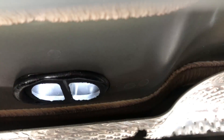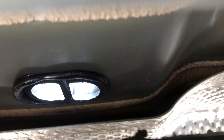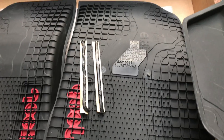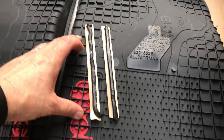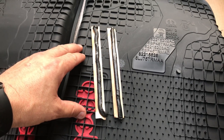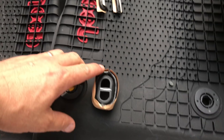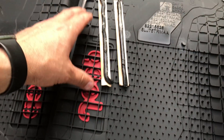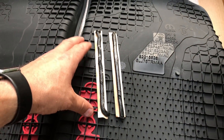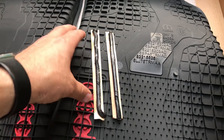This is what it's supposed to do — this is how it should be — a nice tight seal all the way across there. I know it looks a little nasty there on the left, but that's where the biggest gap was. I want to do this two different ways. I've got two 7-inch strips of this butyl tape — this is 3M butyl tape, a quarter inch in diameter, 7 inches long. Seven inches will go directly around there, it's just enough to make it fit. I'm going to offer these two strips on the website jeepinformant.com for $5.95.